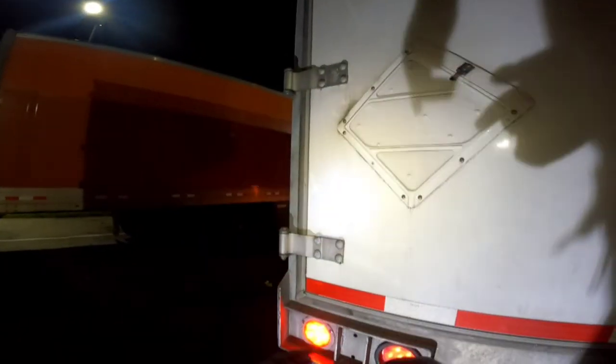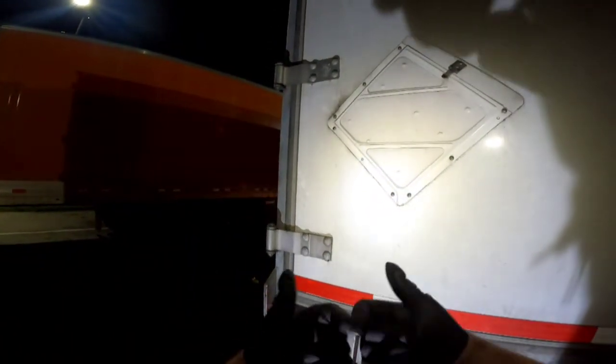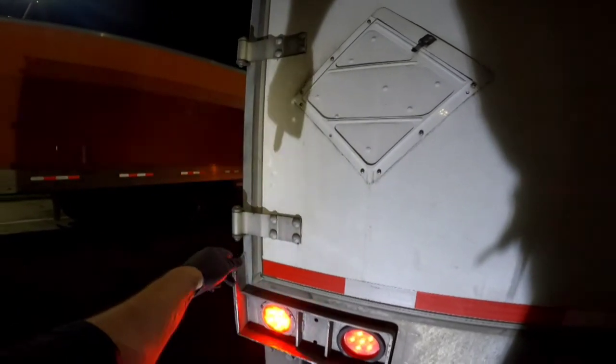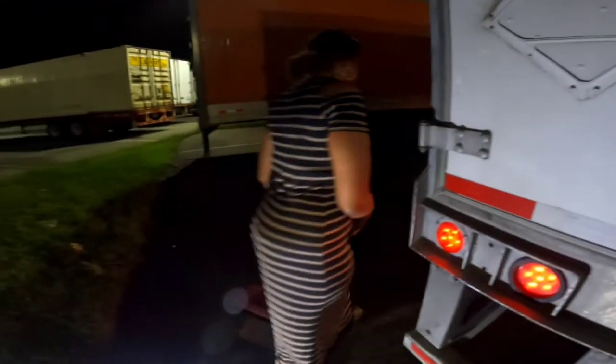Right. Well, there's a tie off. They got it tied off. One wire with 2 plugs on the end. I was trying to figure out where this one went, and then I figured it out because when I did my test for the ABS, that light came on. When I first did it, that ABS light never came on. So that was part of it. So I reconnected them, made sure they're tight. But I just want to make sure your stops work because I was all in there, working in a tight space. And then your right turn too.